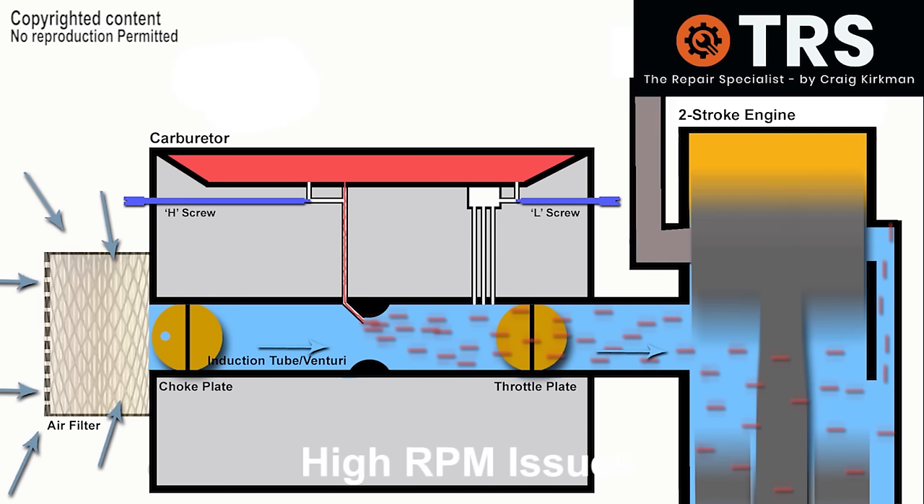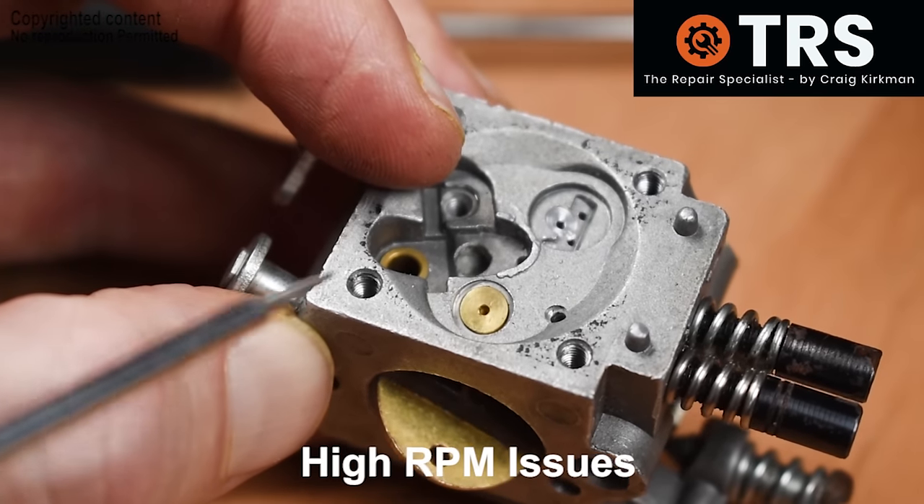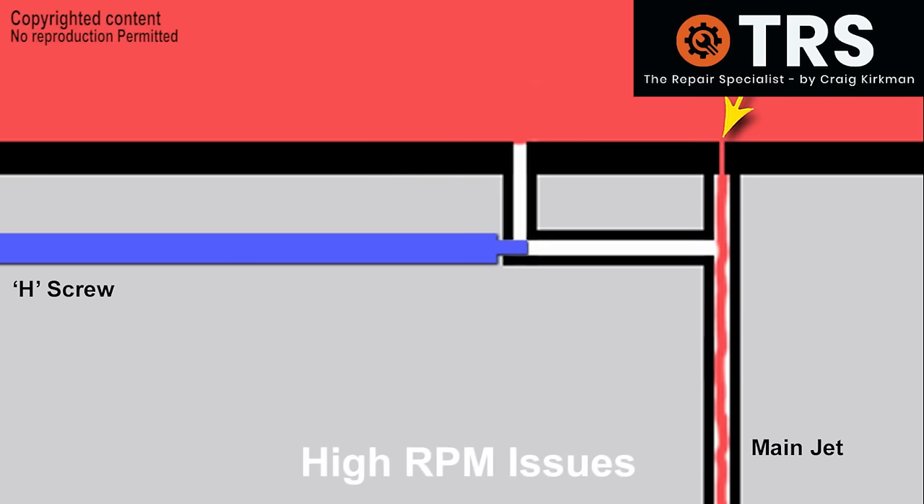To understand how that corrected the problem, we need to look at how the main jet's fuel adjustment system works. In basic terms, when the engine is running, fuel is drawn into the main jet out of the metering reservoir above and down into the venturi. But the amount of fuel that goes this way has to pass through a very small orifice at the top, so only a certain volume of fuel can flow this way. The amount of fuel that can pass this small orifice may be adequate for idling revs, but it's not enough for maximum revs, and a supply from this hole alone would cause the engine to bog when throttling.